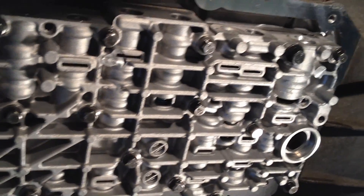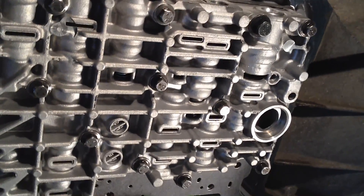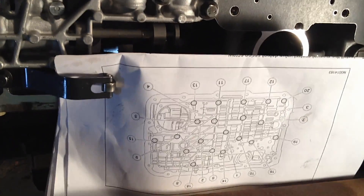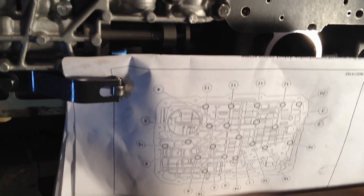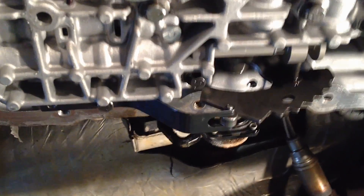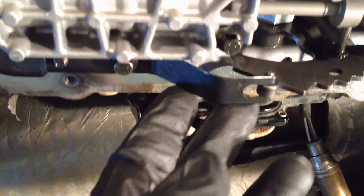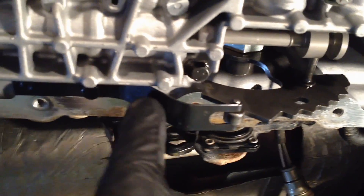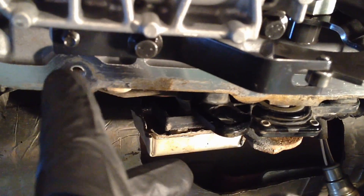This is probably the worst but most important part of the job — torquing all of these to 89 inch-pounds in the proper torque sequence. What I do is put the torque sequence chart right next to it so I can reference it. It's going to be a pain craning your neck, but it's very important to torque all these down properly. Once the valve body is all torqued down, come over to the detent spring and torque that down to the same 89 inch-pounds. Do that last because if you tighten the detent spring first it'll actually block that bolt. Make sure it's seated in that locator.